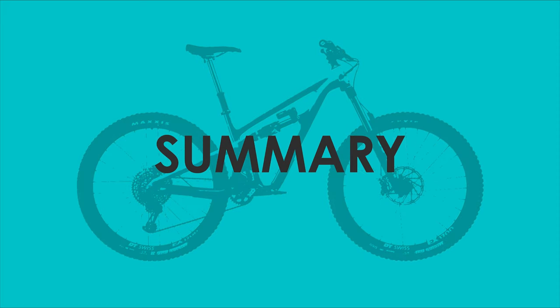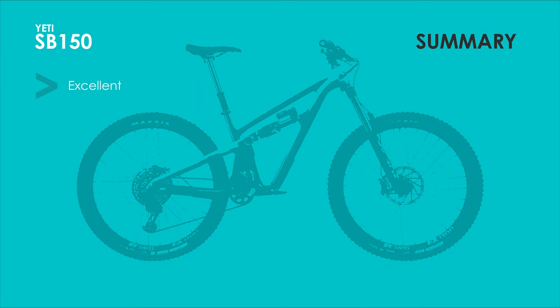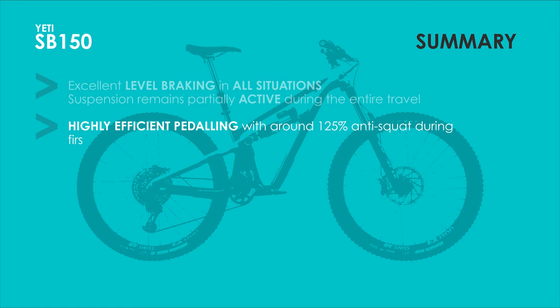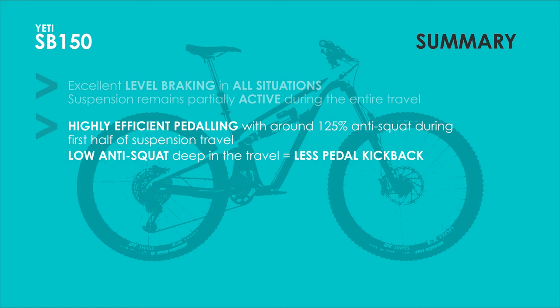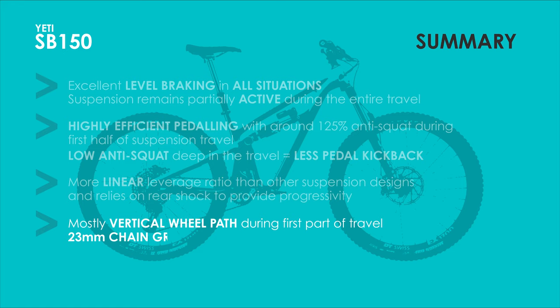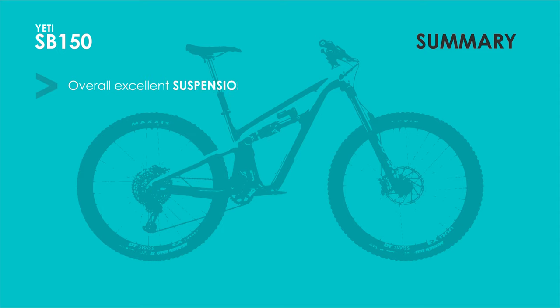So, what's my overall summary of the Switch Infinity suspension on the Yeti SB150? Firstly, the suspension design is such that under braking, the bike will remain very composed and level, while still allowing the rear wheel to react to bumps, with its slightly less than 100% anti-rise values. Secondly, the anti-squat values of this suspension design, being around 125% during the first half of its travel, means that it's going to pedal excellently uphill with very little pedal bob. However, as you get deeper in the travel, the very low anti-squat values means that the suspension will be less affected by chain forces and will remain more active with less pedal kickback. Thirdly, the SB150's kinematics are far more linear than the VPP or 4-bar linkage designs I have looked at so far, and relies on the shock to provide a progressive response to help prevent bottom out. Finally, the wheel path is almost the same as for the 4-bar and VPP designs, with about the same chain growth as the VPP. Hopefully I have convinced you of the benefits of the Switch Infinity suspension — it's definitely better than a single pivot design, despite the very small movement of the lower pivot.